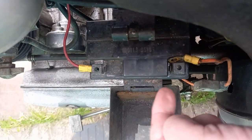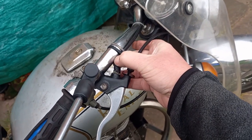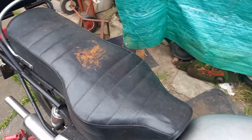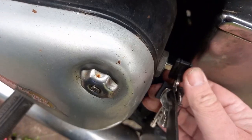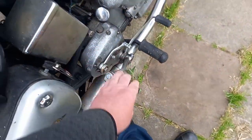Okay, so day two. I'm obviously missing some nuts and bolts but it doesn't matter because I'm getting electrical connection - and all that because the brake light's stuck on. So why is the brake light stuck on? Is it this front switch? Doesn't seem to be making any difference... of course it does, it's gone off. Okay, time to try the ignition now. A little bit sceptical here because I can't remember which way around it's got to turn, but here we go. All right, don't appear to be pulling any current. Now I'm going to try and turn the engine over and see if we get movement.